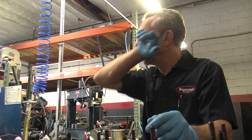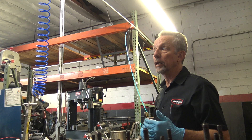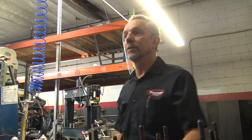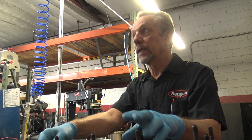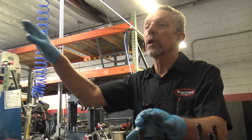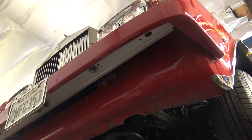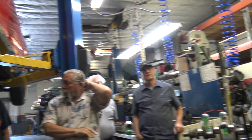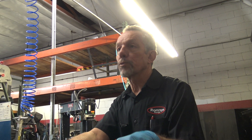This car, for example — if you go in the Rolls-Royce scheduled maintenance, I think at 12 years you're supposed to replace all the brake hoses. This thing had the original ones on; I just did them this week. It's a 1987 with 21,000 miles, so it's not like it's been beat up, and the owner services it regularly. But we're doing brake work on it and a caliper started leaking, so we did the hoses too. I don't always agree with all that over-servicing, because if you have a car for two years and get a $10,000 service bill, most people just go — what? But that's the way Rolls-Royce wanted it done.